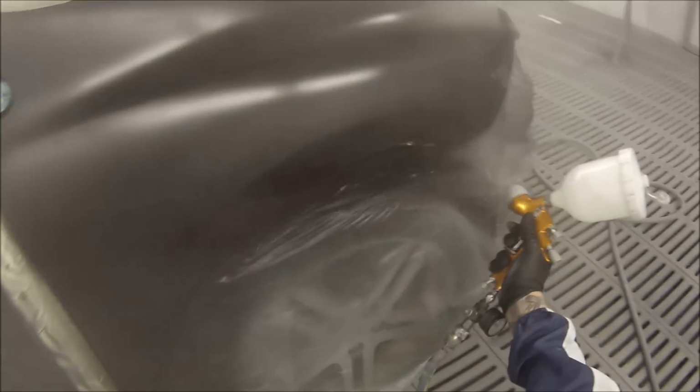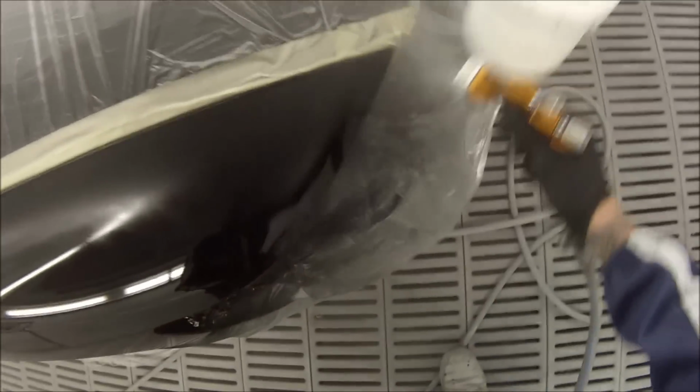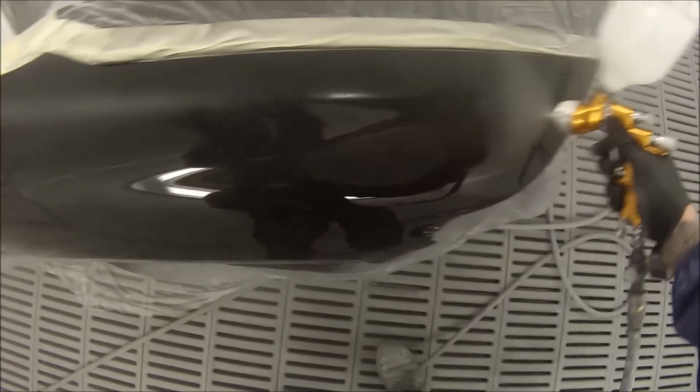So now we're going on with our clear coat, and I'm just using some Duxone 2K clear. It's an MS clear, 2 full coat system, and I don't add any reducer to it either. As you saw there, I'm using the DeVilbiss GTI Pro Lite 1.3mm setup and the TE20 air cap on it. Bit of a favourite of mine, this gun.